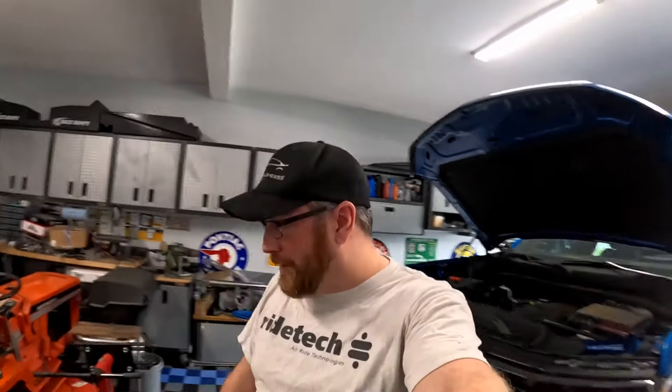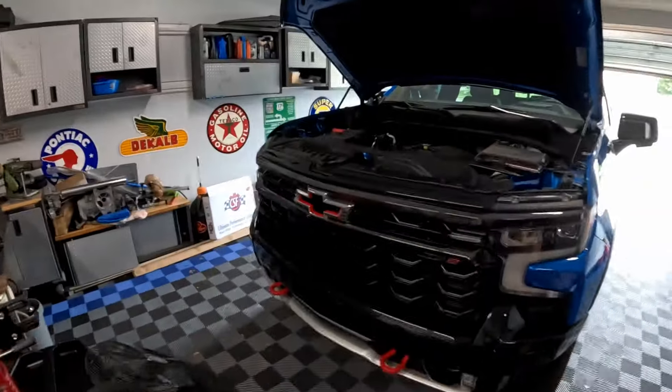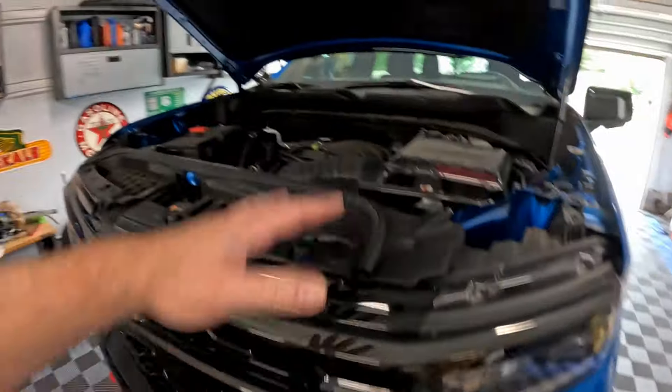Hopefully disconnecting the battery resolves the keyless entry system error. I did see a video where a guy with a 1500 GMC Sierra — same year, the AT4X or AT4 Denali — hit the lock and unlock button for about three seconds to reset the system. The side lights lit up on mine too, but the error didn't go away. Since we had those two modules disconnected, I assume a fault code got thrown and disconnecting the battery is the way to clear it.